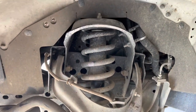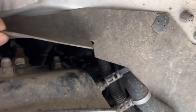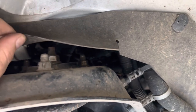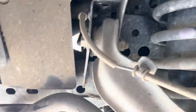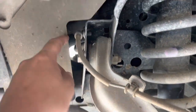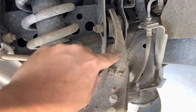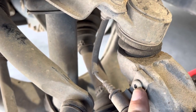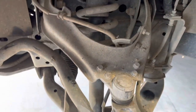There are three bolts on the top of the strut behind a little flap — it's just a protection strip to stop mud entering your engine bay. I'll also undo the wheel speed sensor, it's got two clips. It runs down the back behind the upper control arm, there's one bolt, and then it runs down onto the bottom of the stub axle and into the back of the wheel. We'll remove that and get it right out of the way — it's just one less thing we have to worry about damaging if we move it first.